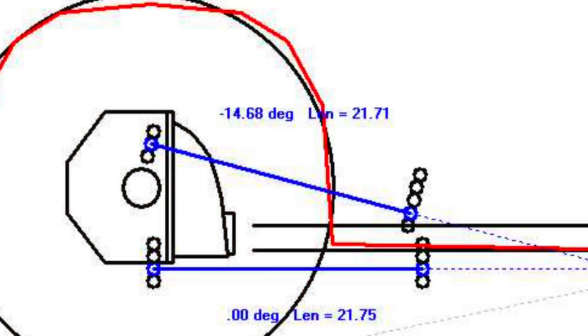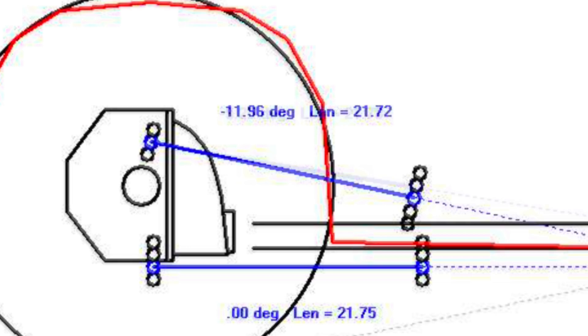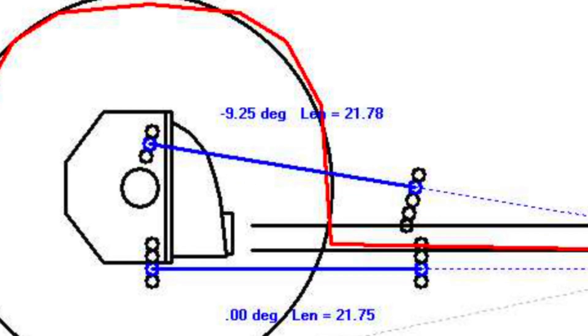Some information to set up what we're going through: the bottom bar on this car is pretty much parallel to the ground — no uphill, no downhill angle. We're going to look at the four-link plot of all three runs and what the change did. The only change from video to video is the upper bar angle. We'll start with the upper bar in the second hole from the bottom on the top, then move to the third hole, then the fourth hole, so you'll see exactly how the car reacts with a big tire slick, Turbo 400, and a decent stall speed on the launch.